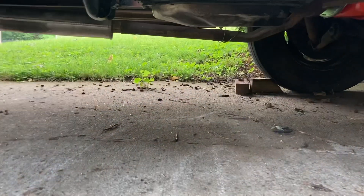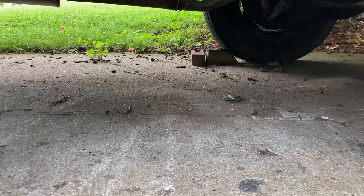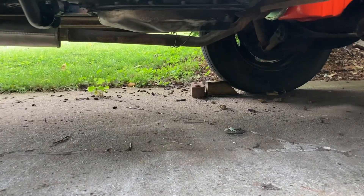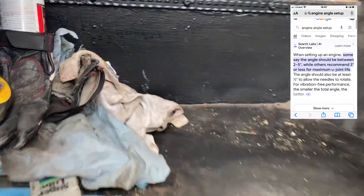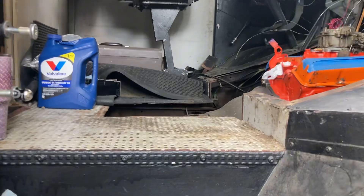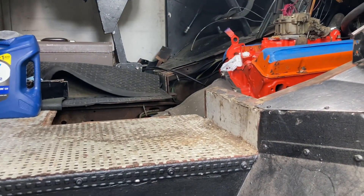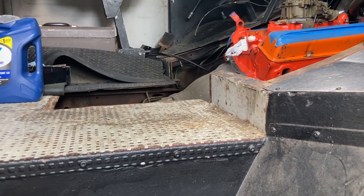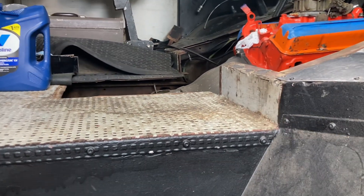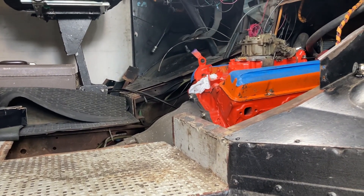You don't really think about all the little things you have to take into account when you do stuff like this. You don't want your engine level to the ground. I think I've seen somewhere three to five degrees for the engine. I was kind of irritated by how angled that engine looks when you look at the level of the floor — the engine pitches. But I guess that's what it's supposed to be. And of course you also want oil to flow into the pan and to the back of the pan. The carburetor needs to be level, from my understanding.